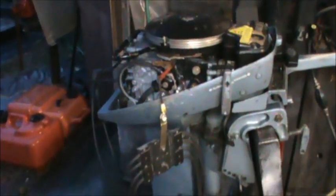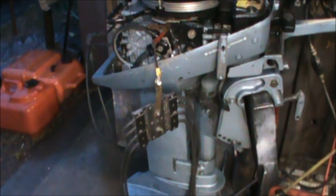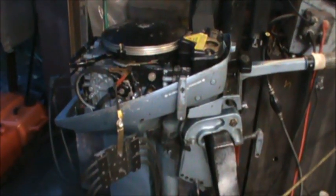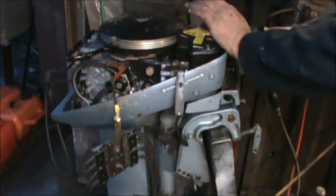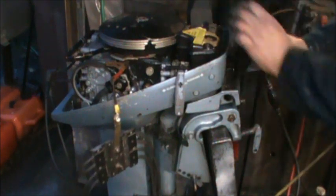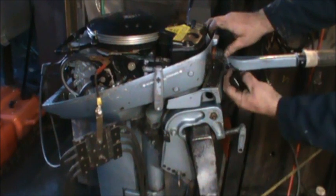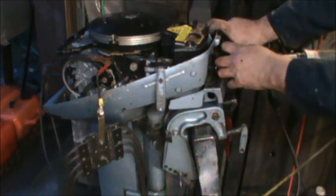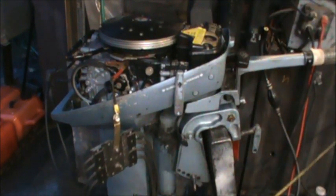So, you can see the Sparky Spider. Let's look right in here. Well, let's see. I want to get the big picture. We need the big picture in there. Yeah, I got the big picture. Okay. Should be able to see sparks right there. Woohoo. Now, there's your spark. Now I'm going to push the kill switch right here. Should see no spark. I'm going to let it off. Should see spark. One kill switch down. Let me get the plugs in.